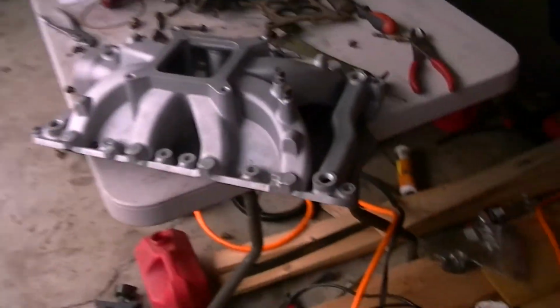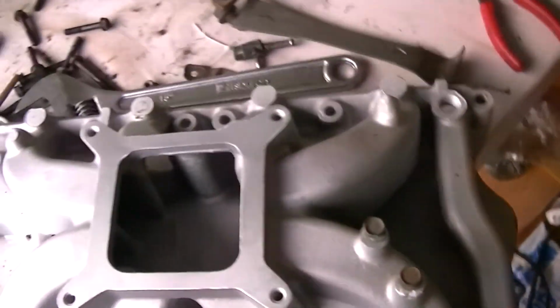You know, it's funny, I was looking at the Edelbrock equivalent of this, and they don't have a rear water passage. So I'm kind of glad I got that one, because now we'll have full circulation around the motor, which is good. Yeah, I'll get a towel and wipe up that coolant. Since I'm not getting a valley pan for this, because I can't find one, I'll have some extra money to do an oil change. We're gonna put Royal Purple in this.